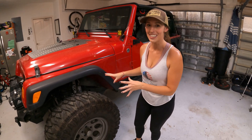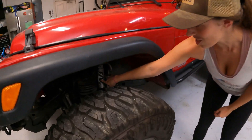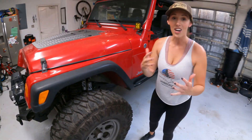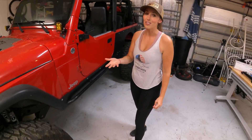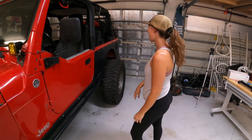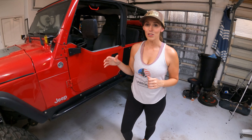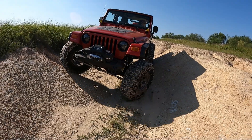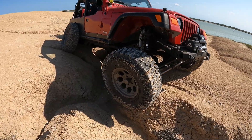I have a bit of a funky setup in the front. After the JK axle swap last year, I needed some new shocks and I found these Fox shocks with the remote reservoir on Facebook Marketplace, but these are designed for a JK. I love Fox shocks and how they ride, but these are a bit stiff because they're designed for a heavier vehicle — that was fine for moving from Virginia down to Texas, but it's now time to change those out. At the rear, I'm also running Fox shocks but those are designed for a TJ and are just a bit too short. Last time we took the Jeep out to test the 37s, we really noticed that pretty much all the shocks are limiting my flex and travel, both front and rear. So we're going to get these replaced.